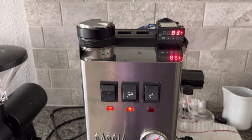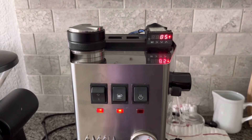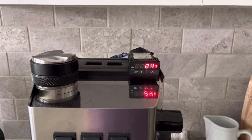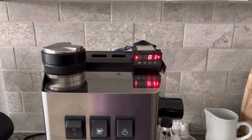The indicator on the PID on the left is controlling the heat up for the brew temperature. The indicator on the right is the alarm setting, and that's controlling the solid-state relay for the steam setting.